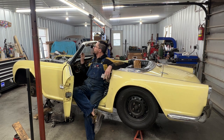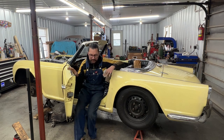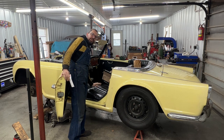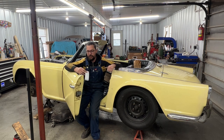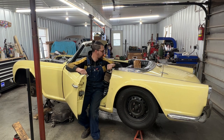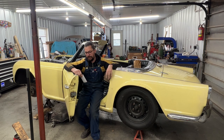We're going to install mirrors on both doors, and probably take the door cards out for that. While we're there, we'll look at the window winders because they don't go up and down very smoothly — something probably needs lubricating. We also have to install some weather strips on the sides, and the seats need to be padded a little. The foam inside isn't great but we're going to rebuild what's there.